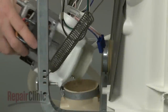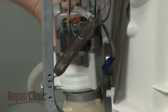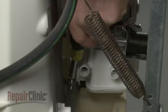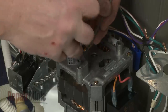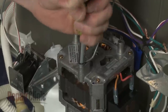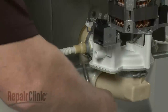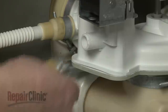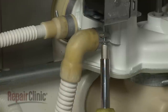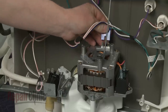Reinstall or replace the assembly by inserting the inlet port into the sump as you align the outlet port with the pump connector. Tighten the clamps to secure. Position the support rod and secure it with the screw. Attach the upper spray tube and the chamber hose to the appropriate ports on the pump and tighten the clamps. Connect the wire harnesses to the terminals on the motor and the solenoid.